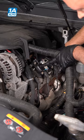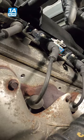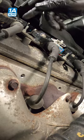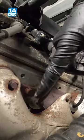So your vehicle's running rough. We're gonna show you a quick and easy way to figure out whether you have a misfire coming from one of your spark plug wires. Here we have our coils and our spark plug wires, and below that would be the spark plugs themselves. While the engine is running, we're gonna actually use some soapy water and spray it on the spark plug wires.